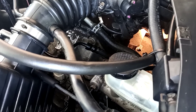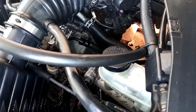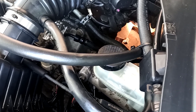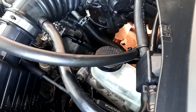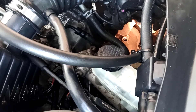This is for a 2005 Ford Taurus. What you're looking at down there is the top of the transmission, and that's where the variable speed sensor — or transmission speed sensor — is located. You can see a bolt hole and the hole where the actual sensor goes in. I'm just going to refer to it as a variable speed sensor.